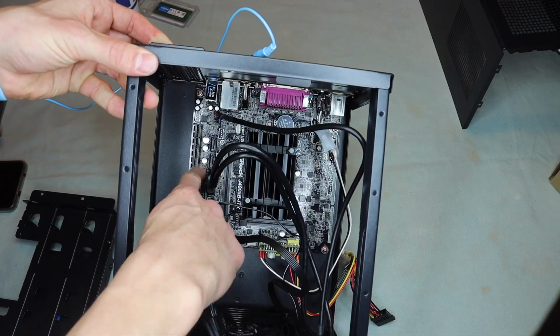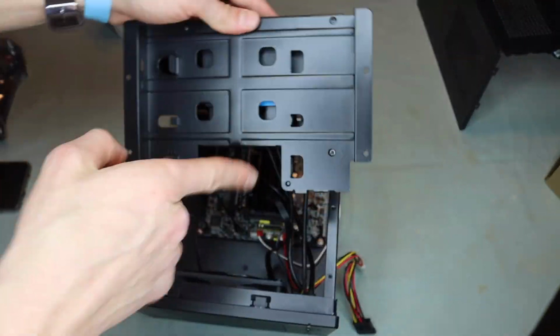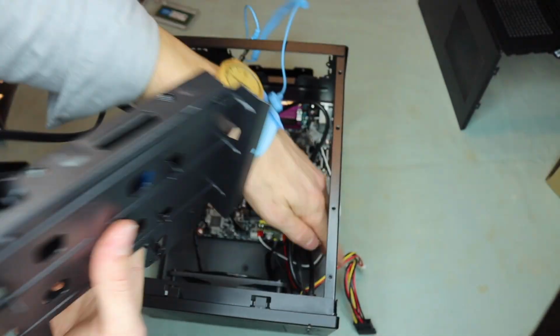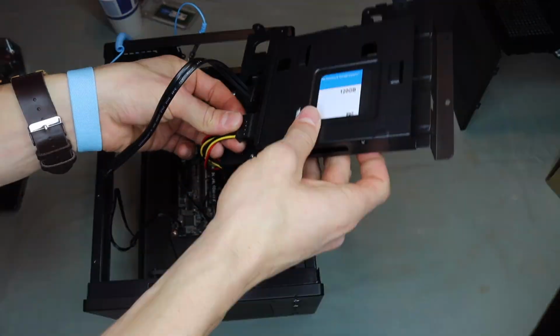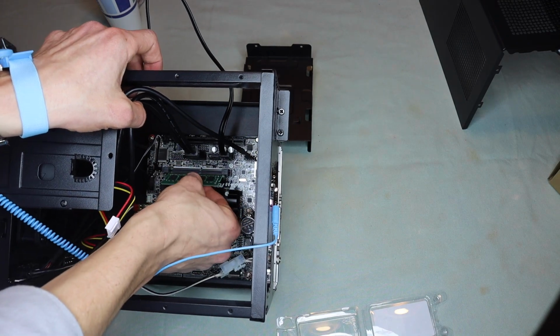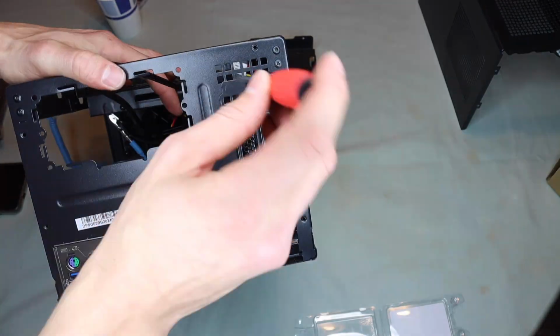There's a SATA cable, going to connect that, as well as the black cable from the PSU that connects to the SSD. They both have a little L shape that matches up with the port. Undo the clips on either one of the RAM slots, slide in there and redo the clips, and then it's time to put in your graphics card.